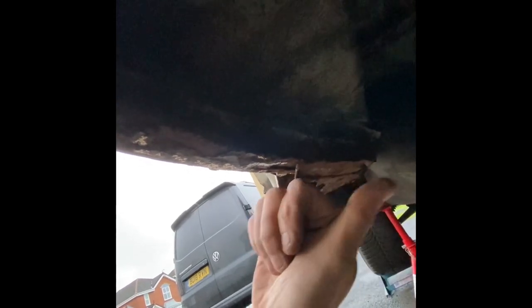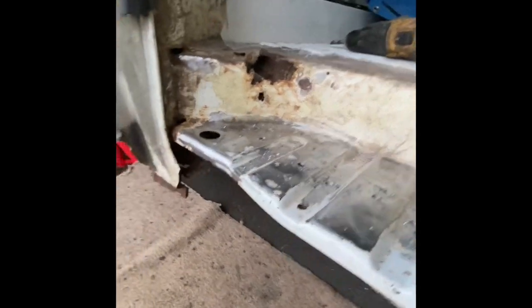This is the area — you can't see it quite yet because there's so much gunk, filler, and underbody sealer. But where this goes up, it bends out to create a flange where it's been welded through. So I'm going to clean all this up, then hopefully get a putty knife and hammer and get behind here to separate this piece off, now that those welds are hopefully gone, and then work on separating this area towards the back. You can see where it's all rotten through — that daylight is coming from here, so water must spray up off the back wheel and rot all this out.